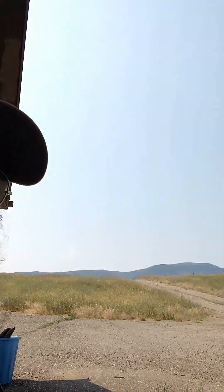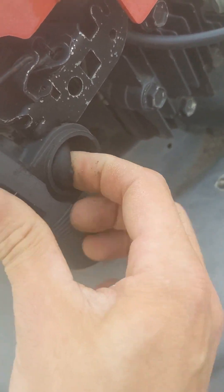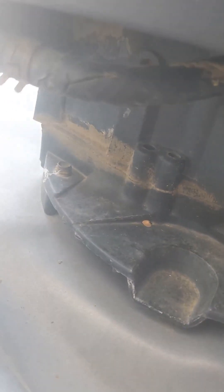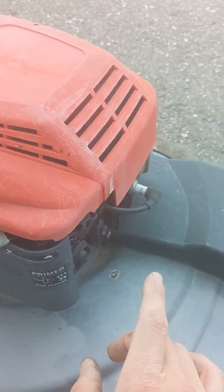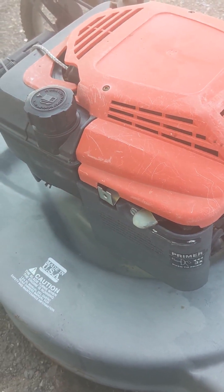Welcome back — we're actually outside today at Maria's house and we have a broken lawnmower. I brought a few things down so hopefully we can get some things fixed. The bulb has a hole in it, there's a crack at the bottom, and over here on the gas line we also have a crack. I bought a new bulb — I don't know if it's going to fit but we'll see — and I got some gas hosing. I'll try to get both replaced, then check that spark is still working, add gas, and check the oil while we're here.